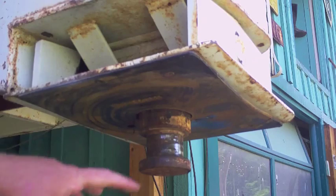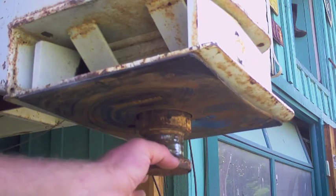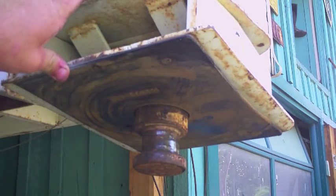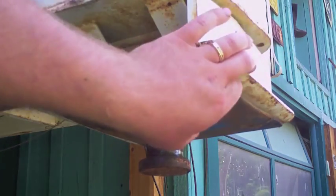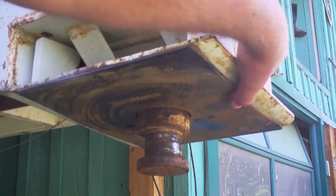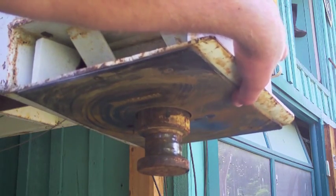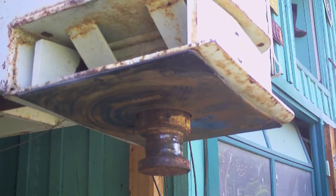It's perfectly tight, the hitch pin is okay. It's got a touch of a flat spot in the back, but you'd expect that with nearly 20 years of towing. And if you haven't treated yourself to a nylon pad, you really should do so. Now it does appear that I probably should replace this because not only is it buckling, which might catch when I hook up, but it's also cracking along in here. So everything up there looks fine.